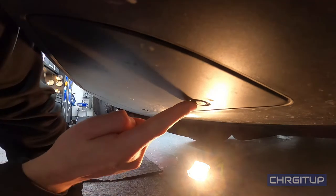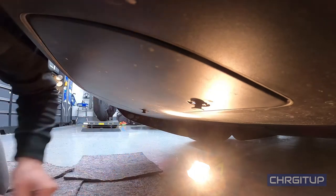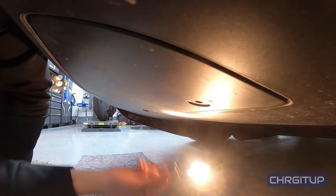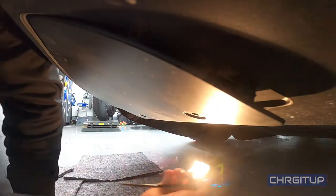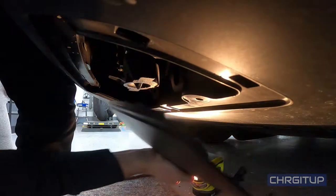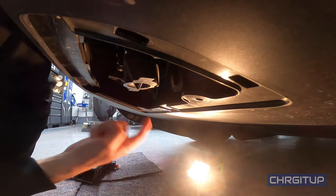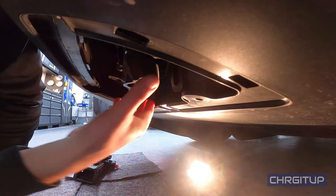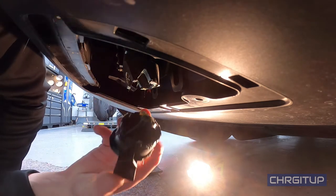At the back of the Model X, the first thing you need to do is remove two little push pins here and here. A screwdriver pops each one out — very simple, very easy. Then on this end, pry it down with the screwdriver, pull it down and then pull it forward toward the front of the car. Take that off and you expose the underside of the receiver. There's a plastic piece on here — just pop that out, but be careful because there is a lot of grease.